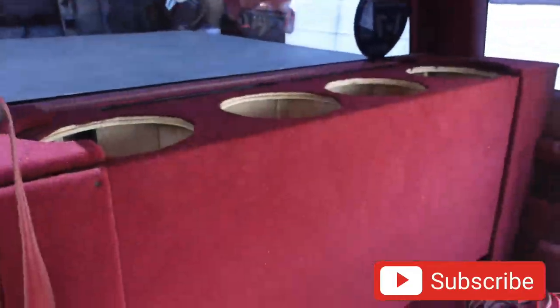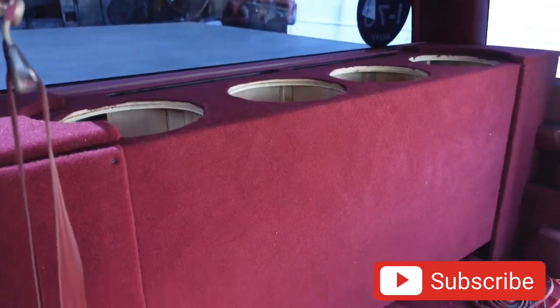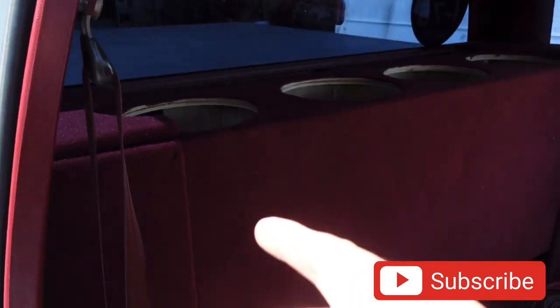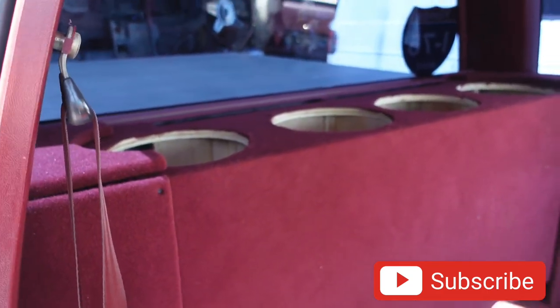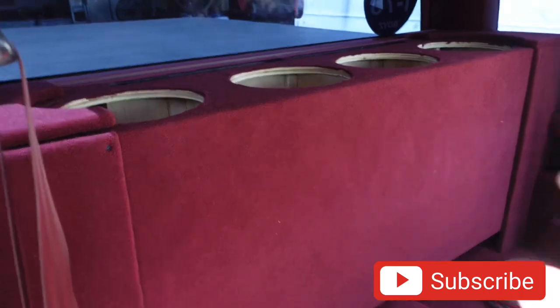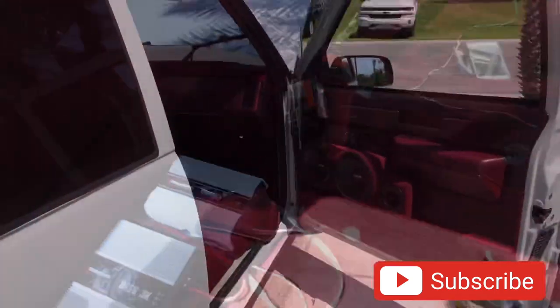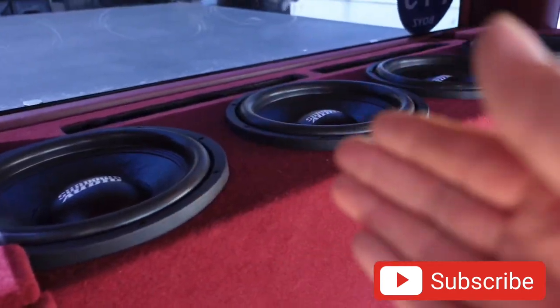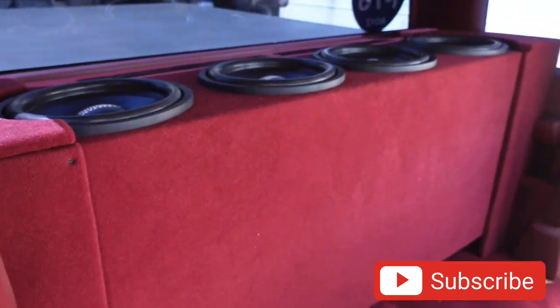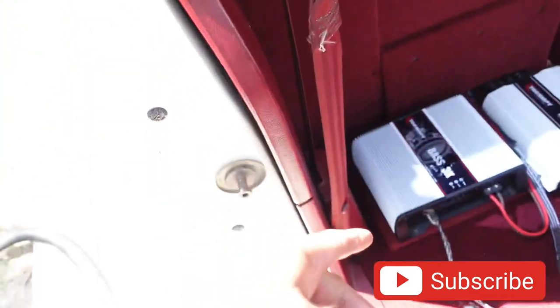The amp is one ohm, so we're going to wire all the subs up to one ohm mono and go parallel on each one until we get to the last one — that's where the wire comes out. The silicone dried so it's sealed. I probably didn't have to seal it but it's good practice since we only want air coming out through the port. The subs are now mounted in and wired down to one ohm — that's what the 3K asked for.